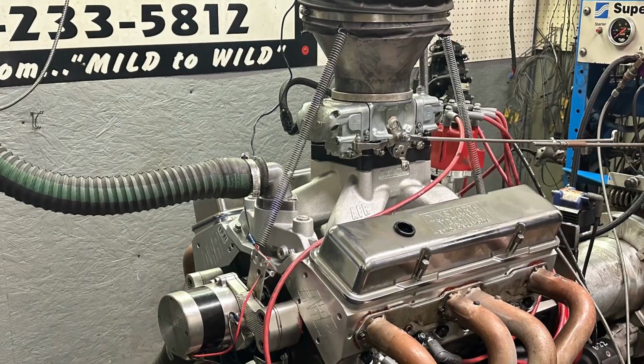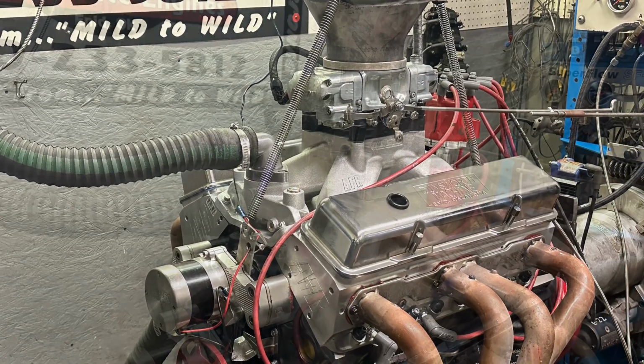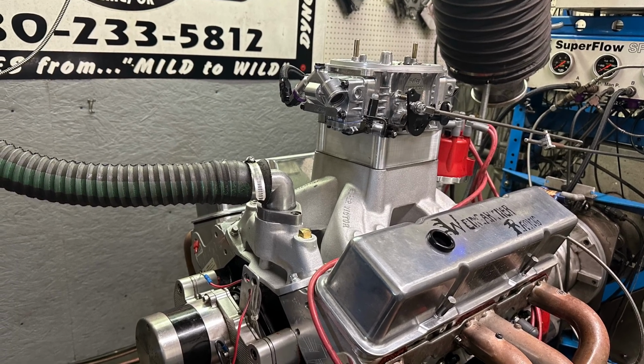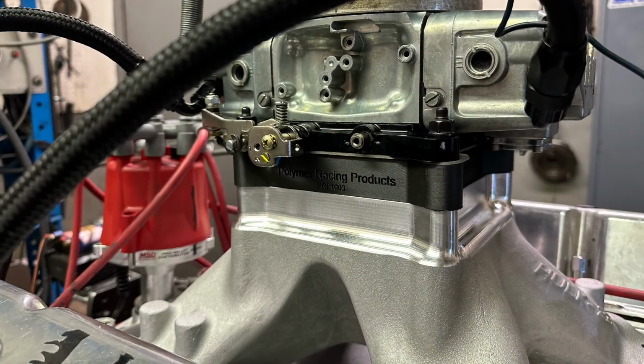Because I have tested this before. If you're new to my channel, you may not know this, but I used to have a 406 small block Chevy dyno mule that I just tested a bunch of stuff on. Now, it was a bit more radical than Nick's. So it was 11.5 to 1 or 11.2 to 1. And it had a bunch of different heads: AFR 227s, the ProMax 235s, ProMax 215s, the AFR Enforcer 195s.